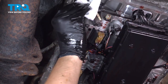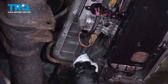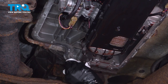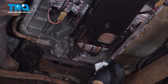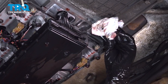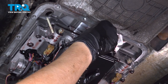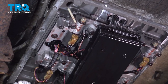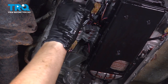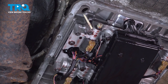Now we want to clean off the surface where the transmission pan gasket mounts, so go around and wipe it off. I won't degrease it yet because fluid will still likely leak on it, but I'll at least wipe it off. I'll leave the degreasing to the end, using brake parts cleaner on a rag to make it nice and dry right before installation so the new gasket has a good surface to seal on. If you have a lot of corrosion built up, try to scrape it off with a razor blade held nice and flat.